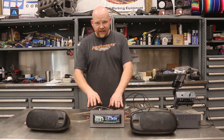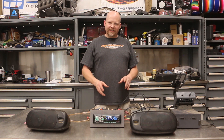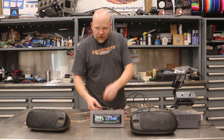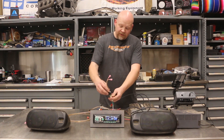For regular listening you would have to turn this down to about 24 — that's your max voltage. So this head unit's internal amplifier maxes out in clean signal at about 24 on the volume knob. Now let me show you what happens on the preamp side.